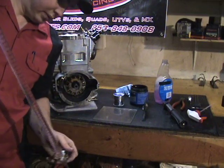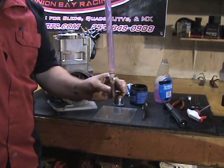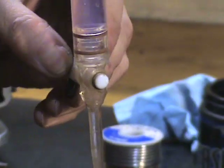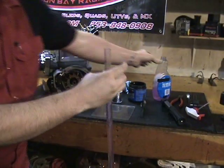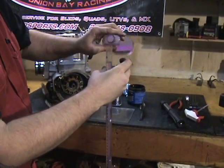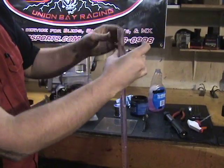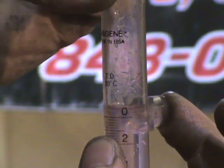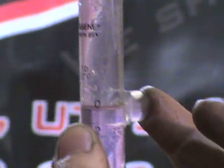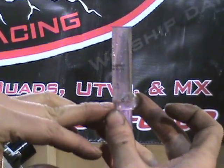I'm going to crack the bottom open here and get any air that might be trapped in the tip. Most of our air has settled out now, so I'm just going to let off my finger and bleed the water down to zero. What you'll notice is on your water bubble you'll see a top line and a bottom line — the bottom of the line is called the meniscus. You want that meniscus right at the zero.